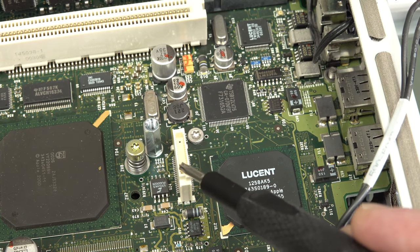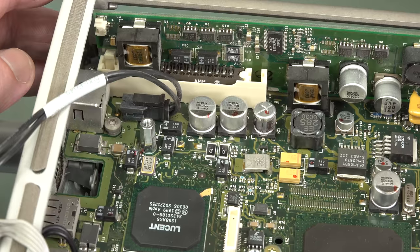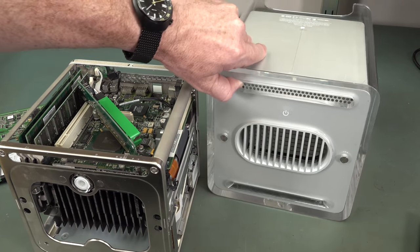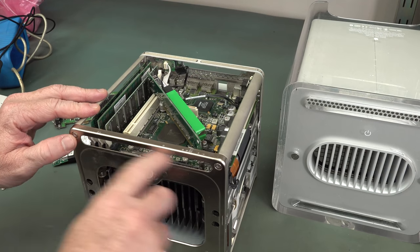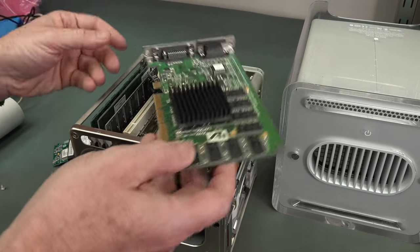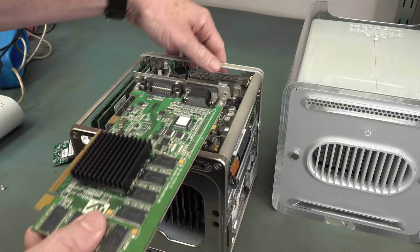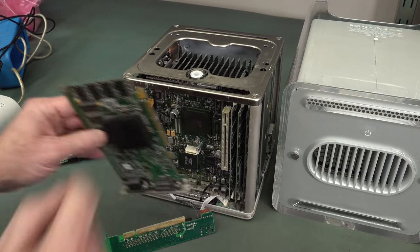Just pan around the power supply slowly there for all you aficionados. It looks like this extra grill on the top - once again, that's for passive convection cooling. That actually lines up with this slot here, which goes over the video card and the passive heatsink on the video card. And yes, they've got the fins in the right orientation. Because if you had the heatsink like that, it wouldn't have been as effective to get the convection flowing. So it comes through the bottom and rises up and straight out the top.